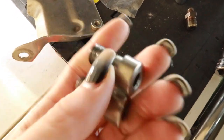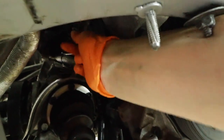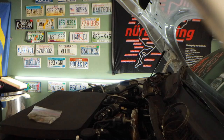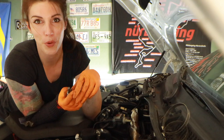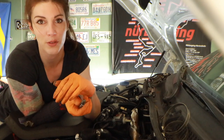I need my banjo bolts to get this turbo buttoned up. I totally forgot — I used one of my lug studs to plug up the hole on the side of the block when I was washing because it's the same thread size. I'm loosely installing all these banjo bolts now so I can get it mounted up on the bracket, and then once everything is in its hole I'll tighten it all down. Strategy. I just dropped my socket down inside the turbo — actually, I got it. There's a bracket attached to this that goes down into hell somewhere over there. I gotta get the bracket that holds it in place bolted up, and just fingers crossed that thing is not cracked from trying to move it around so much.